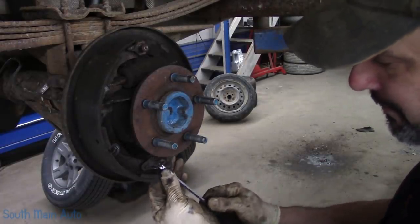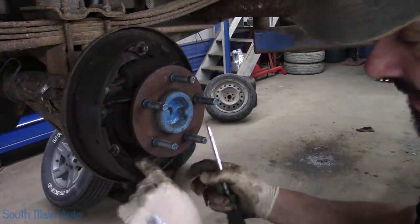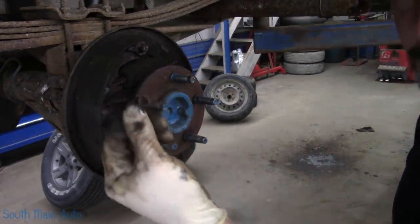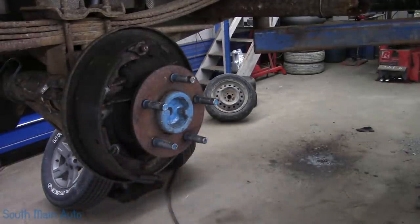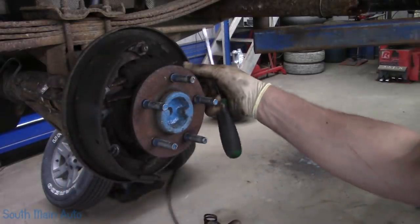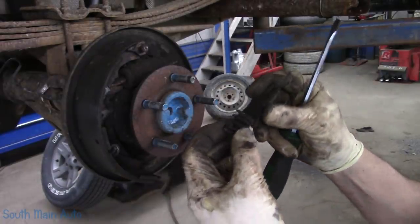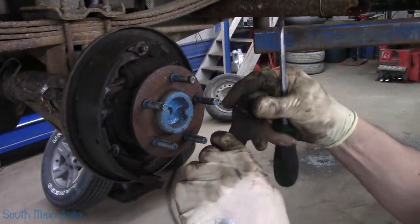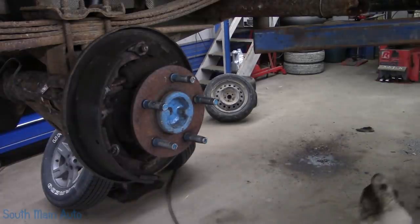Always save your springs because even if you get a spring hardware kit, they don't always come with some of the springs that only come in the adjuster hardware kit. Especially this one, one of the hardest to obtain springs, is the one that goes on the equalizer bar here that runs from shoe to shoe. A lot of times these springs are OEM only. Sometimes you can get them aftermarket. It depends.